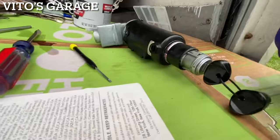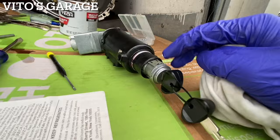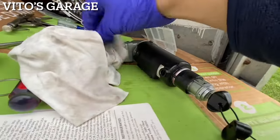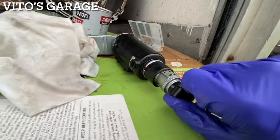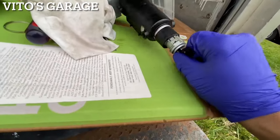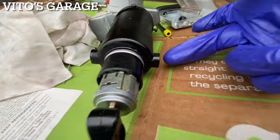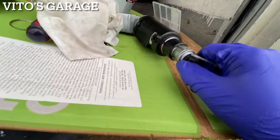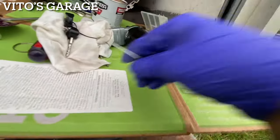When installing the tumbler back, you turn the key a little bit to ON and press it in — it was a really tight fit but it went all the way in. It didn't really make a click or anything but you just have to make sure it goes all the way in. It's working as it should. To take out the key, you have to press where the transmission connects so that slot opens up — and then you can remove the key.